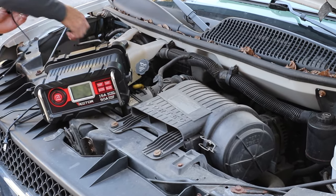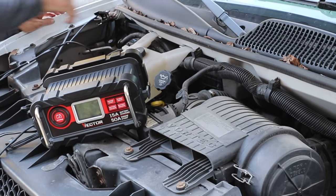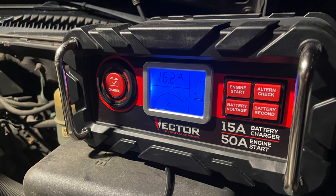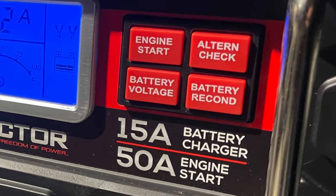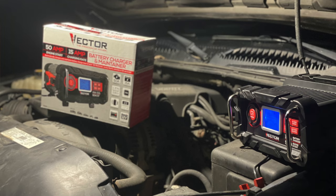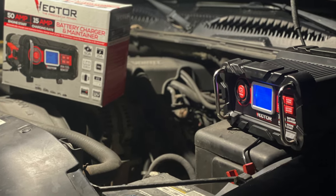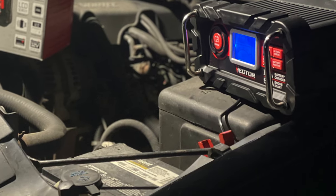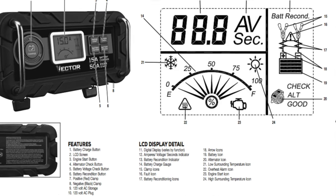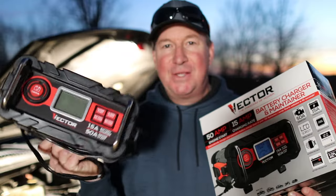The other advanced feature is the battery reconditioning button. You hook this up to your vehicle when it's not running and when you won't be using it for 24 hours. After you push the button, it automatically sends a series of electrical pulses to break up the crystalline form of lead sulfate, converting these chemicals into useful battery electrolytes. The charger stops automatically after 24 hours, and the process can be repeated up to five times. If that still doesn't fix your battery, it's time to recycle it and get a new one. I recommend thoroughly reading the owner's manual.